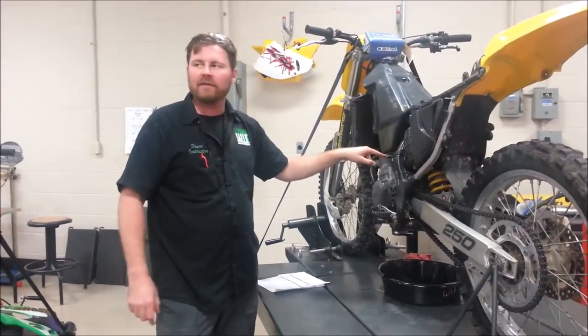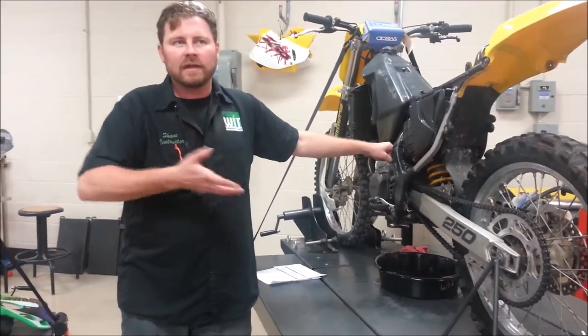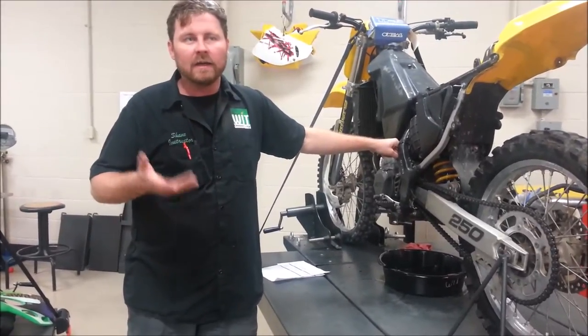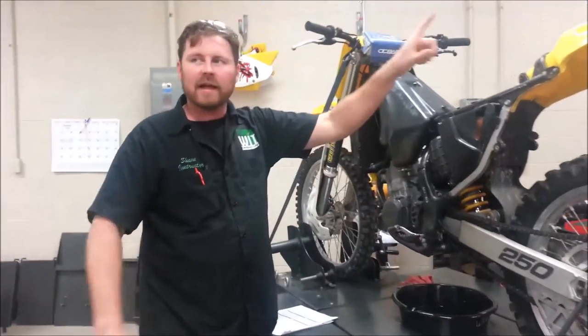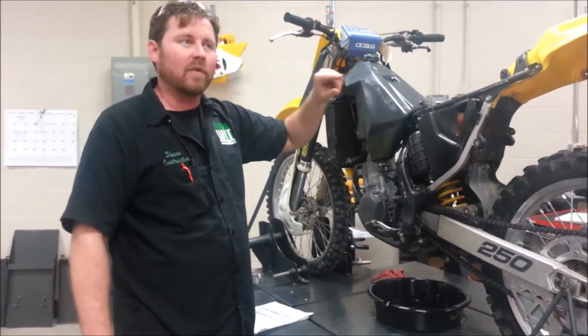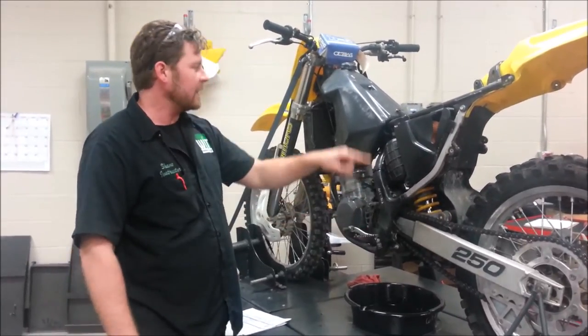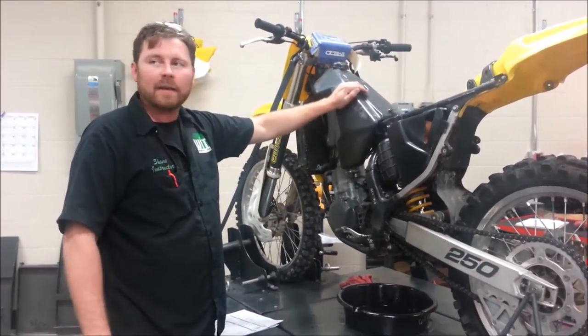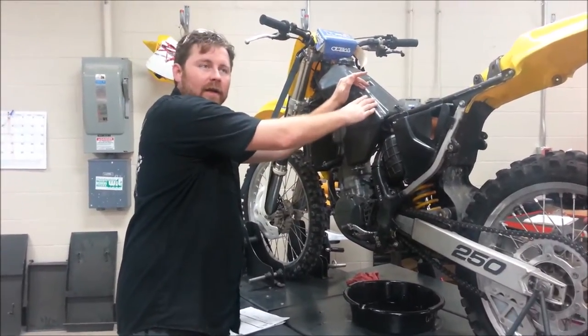If this has a leaky fuel valve, it will overflood the engine and ruin the work that you did. It's just not going to be right, okay? So here's how I do this. For me, I take the fuel valve, thinking ahead of time, especially maybe the night before, and I put a clear piece of fuel line on here, run it in a loop, and tape it to the top of the gas tank or something so that I have like a 6-inch loop of clear fuel line.